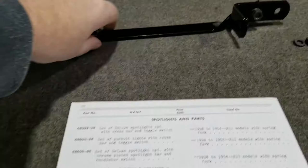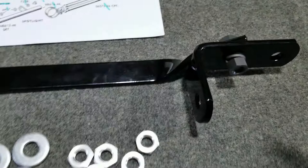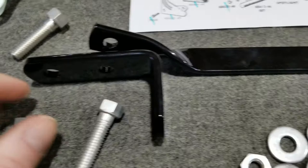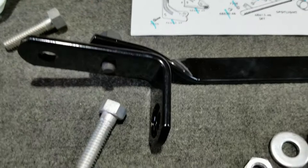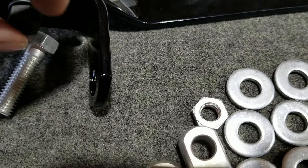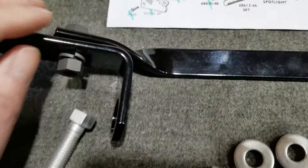Here's what a correct bracket from 1938 to 1945 looks like. These pieces here get bolted on, and this part goes behind the headlamp bracket. According to all the archive pictures I've come across and original bikes, this is all held together with parkerized bolts. This mounts onto the rigid fork, because we don't want the lamps bouncing around on the spring fork — they mount onto the part that attaches to the frame.